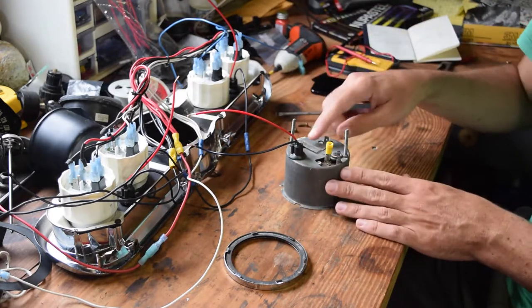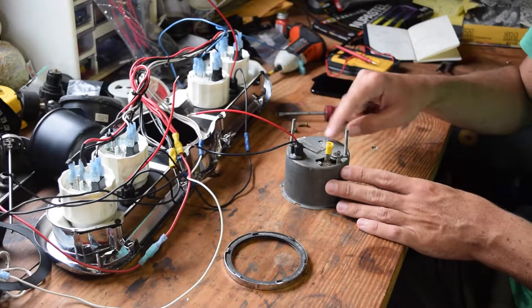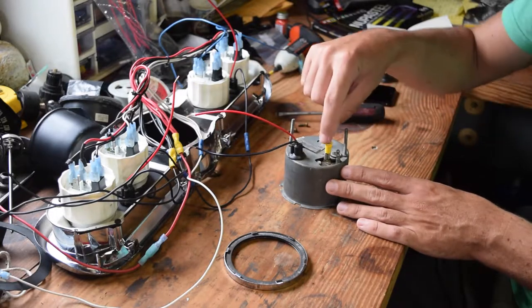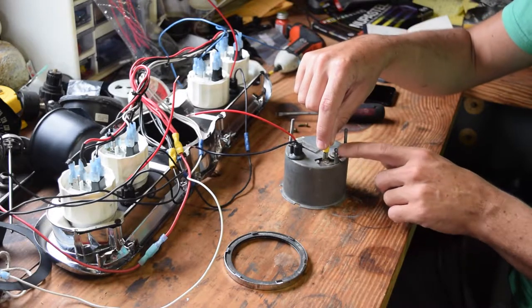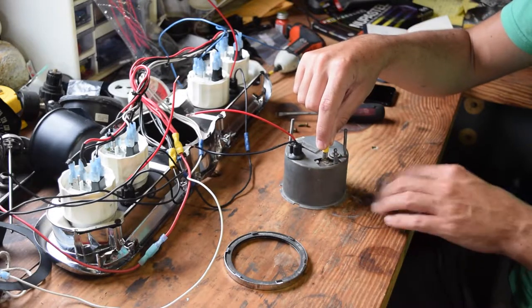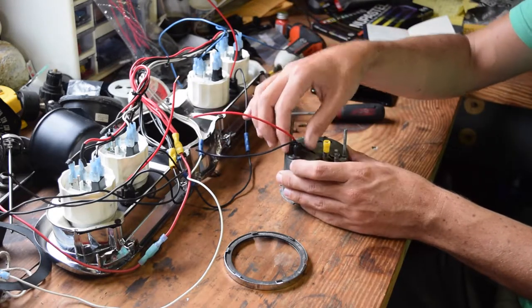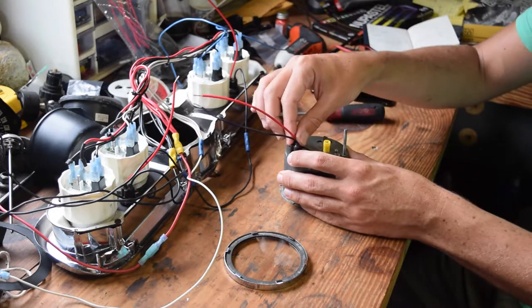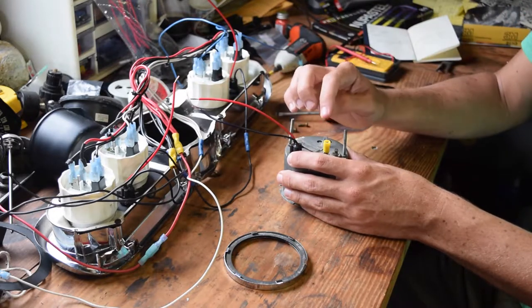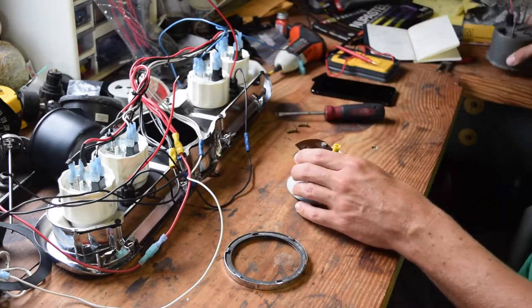On the back here, you have a couple tabs, right? So this guy to the chassis of the tach is ground. This here with the yellow on it, that's power. And then this guy here with this cylinder connector is signal. And what I've done here is I've just installed this light plug so I can use modern LED light bulbs. And yeah, that's pretty much it. So I'm gonna pop this out and we'll look at what I've done on the inside.